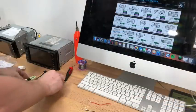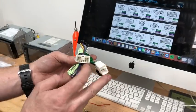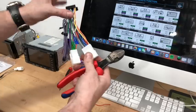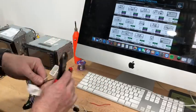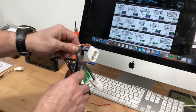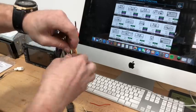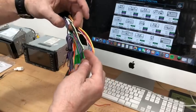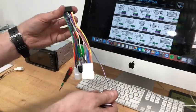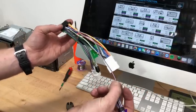The main power harnesses and speaker harnesses are already done. The light green wire needs to go to the handbrake — we're going to cut that off and solder it directly to the black wire so you can use the unit's functions while driving. This bypasses the safety lockout that normally prevents DVD functions unless the handbrake is up, so your passenger can use those features. The reverse trigger wire will tell the head unit to switch to the reverse camera whenever the car is in reverse.